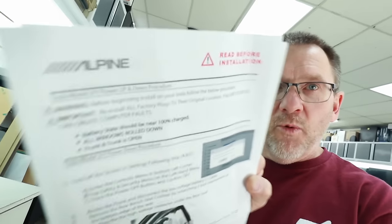The only instructions they actually print and include in the box are the big red warning ones — the power-down procedure. You need to open the trunk, open all four doors. We're going to be doing some sound treatment, so it says to roll windows all the way down, but if you're doing sound treatment you'll want them halfway down to get to the door area. What we've found is that rolling the window halfway down gives us room to add sound treatment to the back area. If the window's all the way down, you can't hook the door panel back up.